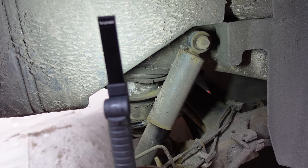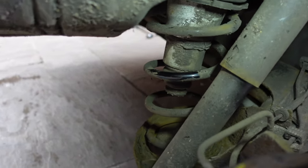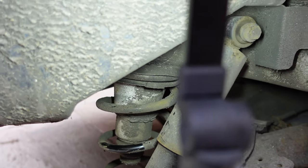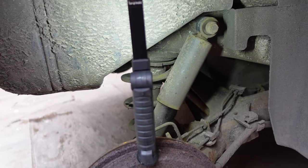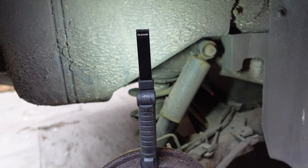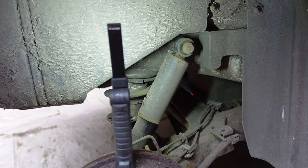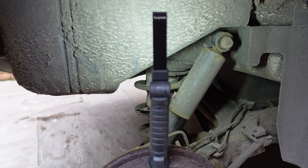Yeah, I'm not even going to take those springs out. I'm just going to give them a good wipe over. They're just dirty. So I think they have been changed recently by the looks of it. Although they came up on the MOT, which was a month before I got this car — less than a month before I got it. So it's a bit odd, because they wouldn't have got dirty like that in a month, would they? I suppose it depends on the mileage. Anyway, I am going to set you up and we are going to do the shock absorbers. At least then we can say springs have been replaced but not by me, they've been cleaned up, and the shock absorbers were an advisory. So no expense spared. They weren't making a noise, but because of an advisory I've changed them. And it's now started to spit with rain. Wonderful. Right, let's get on.